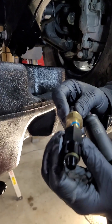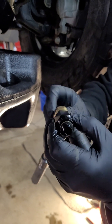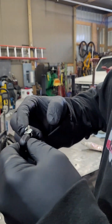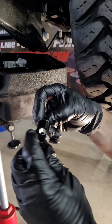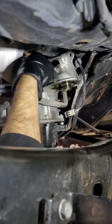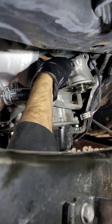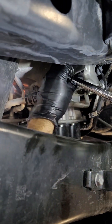These are O-ring tapered and flared so you can use either one on either side. Use thread sealant — not tape. We're going to install the T fitting. As you can see, this T has got three ports on it; our newer ones will be a swivel T. Now I'm going to torque it to 60 inch pounds.